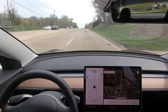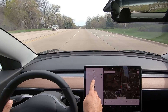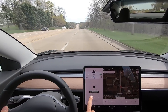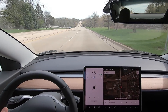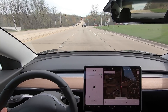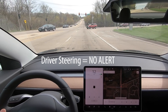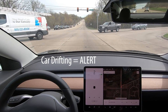In one last example, I'm driving on a local road, on autopilot, and I take it off by shaking the wheel a little bit. I let the car drift — that's the key part — while I'm still on TACC, I let the car drift over a center line and it alerts, highlights the lane line, and then re-centers the car. It does that to let you know you've come off autopilot and need to take control. When it didn't work in the second test, it was because I was actively steering across the center lane and the car knew I was in control. That's the fundamental difference — and in a nutshell, that is the lane departure warning system.